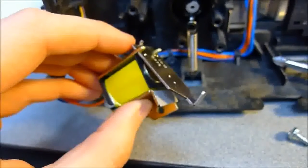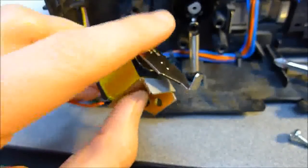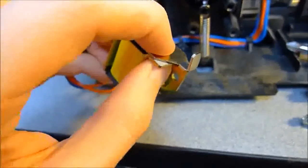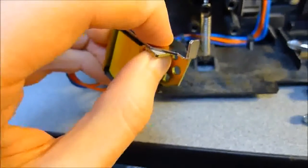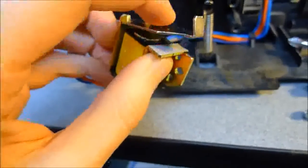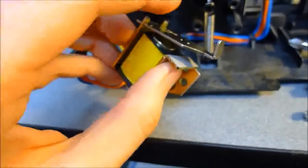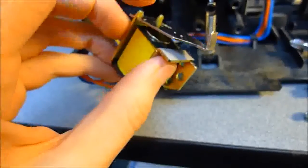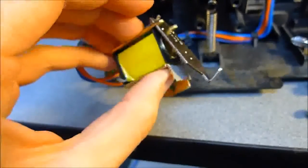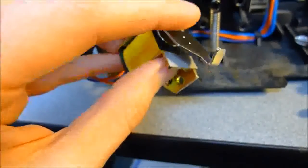Once you've taken care of the other two solenoids for Tray 1 and Tray 2, right before you put it back on, go ahead and give it a try. You should be able to press on the armature really hard and still not have it stick at all. That should confirm that the adhesive, thanks to the little electrical tape placed on there, is not going to pose a problem, and we're not going to have any issues with residual magnetism either.